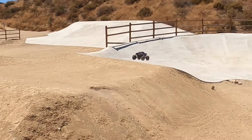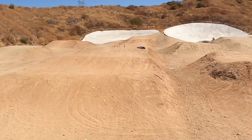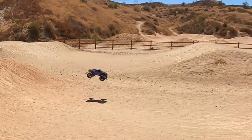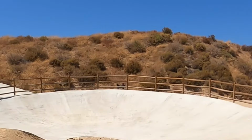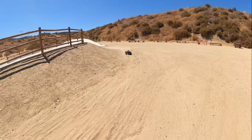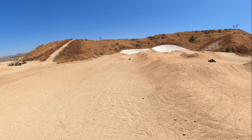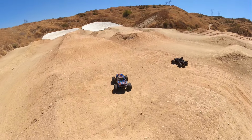Already crashing. I can still hear the noise under hard acceleration. Well, that sucks. Yeah, I know the gear noise is a little loud. I tightened the rear cover for the idler to the cush drive, so I'll probably have to shim it again.